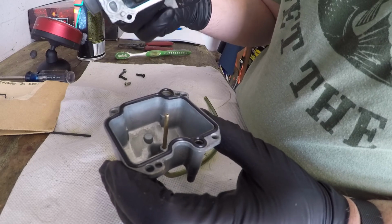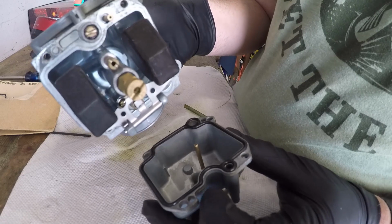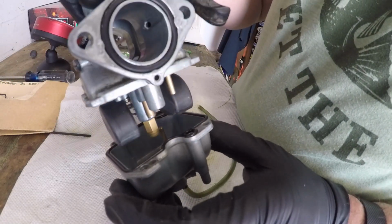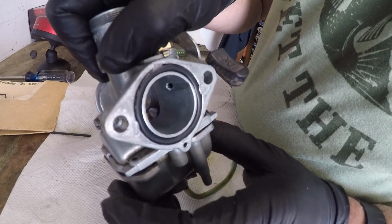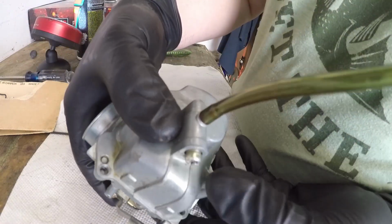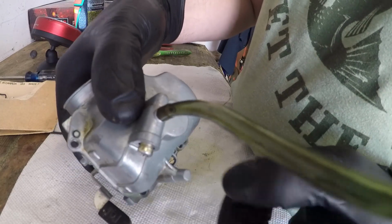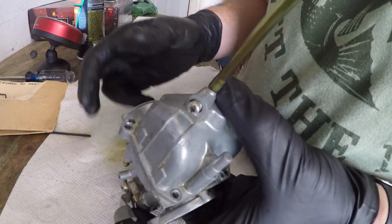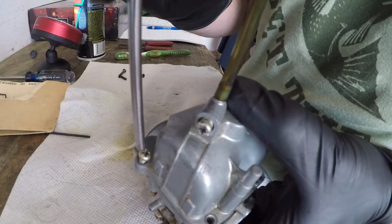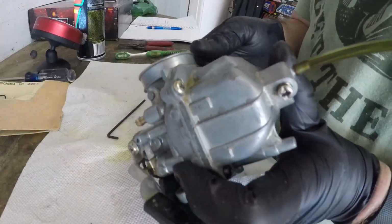Okay, and we're gonna line it up. So the bump here has to make room for our adjustment jet, fuel jet. Okay, nice and straight. Everything stayed in. The bolt holes for the carburetor look lined up, and you can see right through these guys. Okay. Let's get this on here. Okay, snug. Good to go.